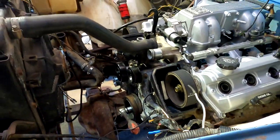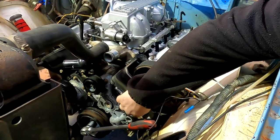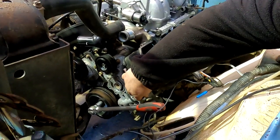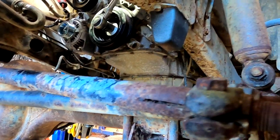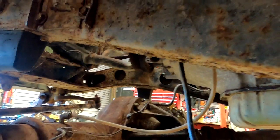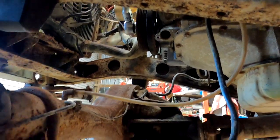Josie has been playing with cam positions to determine where the positions are — checking for a trigger past the crank sensor. Ideally the sensor should be halfway between triggers. They think they've got it correct because they can't just change the software on this old dinosaur ECU. It takes a little extra time to check and sort correctly, especially since it doesn't have the Lexus subboard in it. The loom is coming out really nicely.